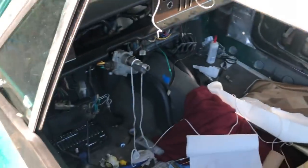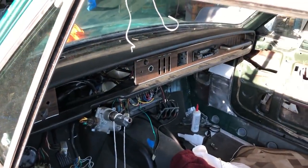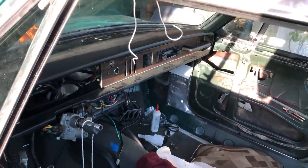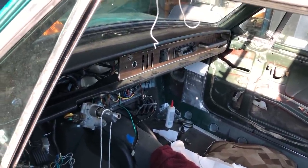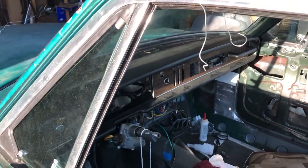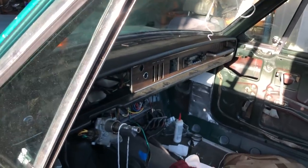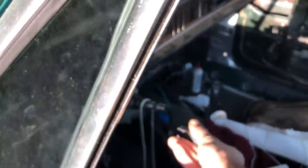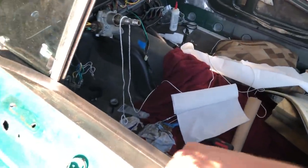Let's appreciate the dashboard. Once I figured out that the steering shaft does not go through the gauge cluster hole, it wasn't that bad to put it in. My biggest concern was cracking the old vinyl — it has a little bit of bend to it, but I do want to lubricate it nicely so that it hopefully has some moisture that it can soak up. It doesn't seem like much moisture can be added to old dried plastic, but at least we can hope to prevent more cracks in the future by keeping it all lubricated using Meguiar's UV protectant or 303 Aerospace Protective. She's becoming a car, slowly but surely. I also had to magnetize the screwdriver because the screws — it's just harder with the rubber edge inside. I should have put the dashboard in completely and then done the windshield, but it's all good. We got there.